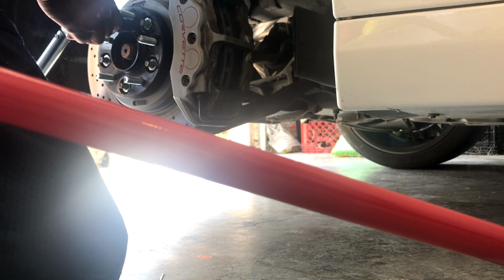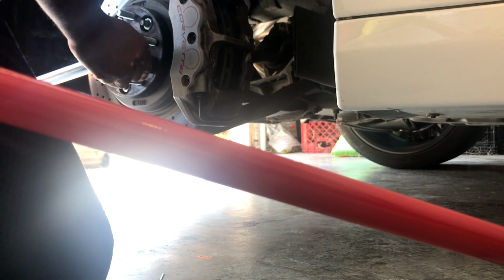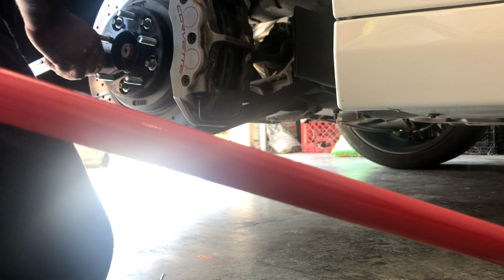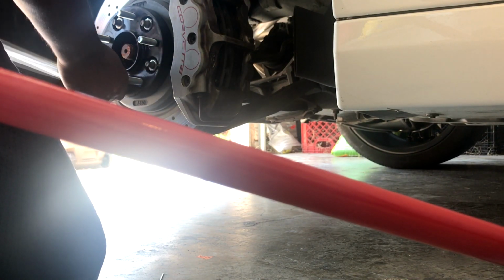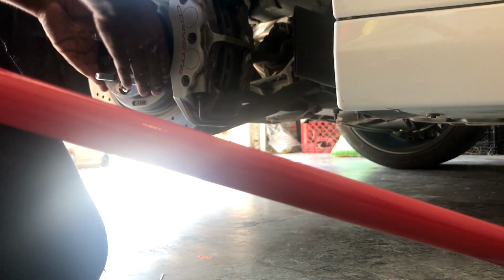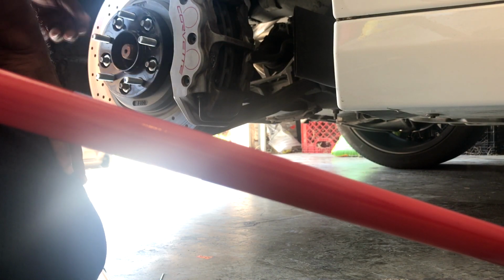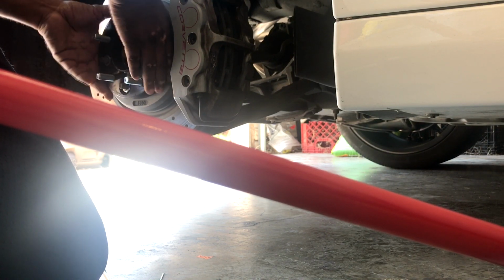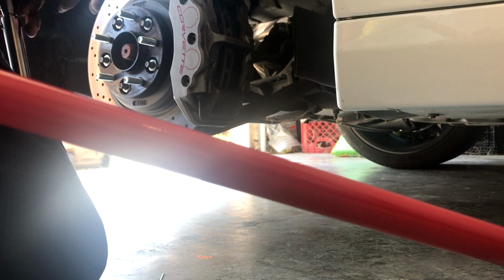When you hear that click, if you haven't used a torque wrench before, that tells you you are at where you set it. And these are on here. Did I check this one? And these are 100 pounds. Now what I do hope is that when I take this off to get a rotor or whatever, these ain't done, you know, with the heat, welded up on here. Let's hope not.